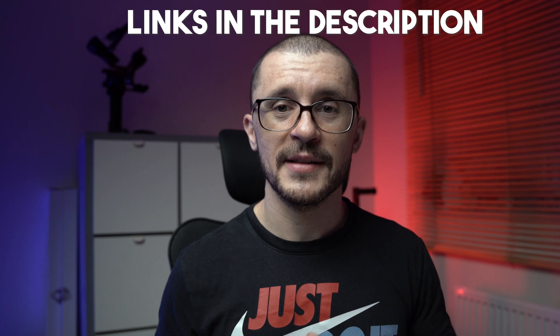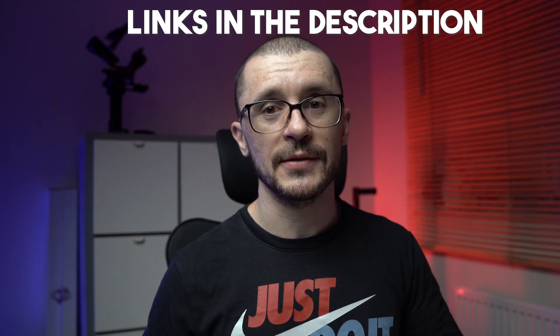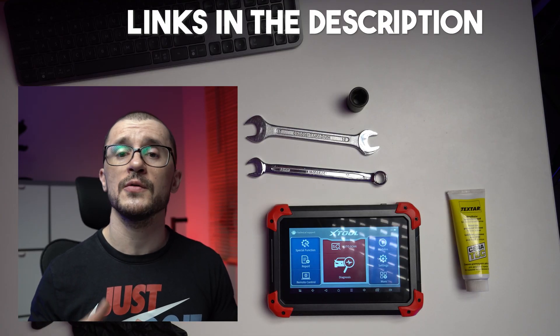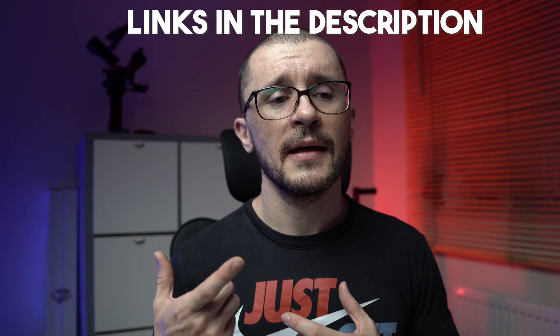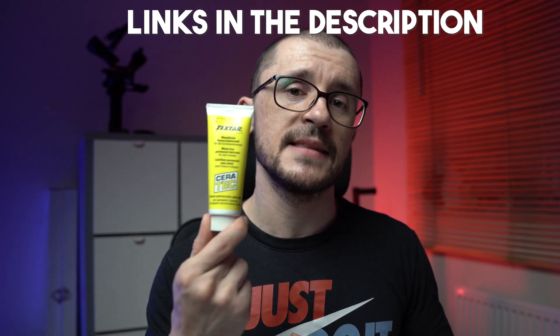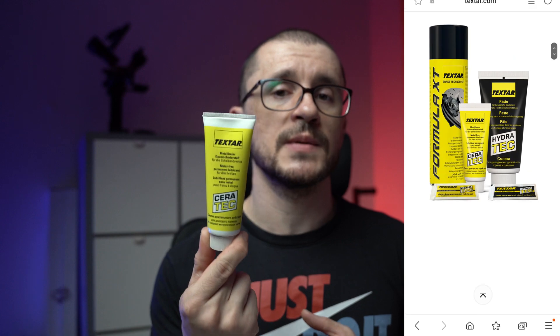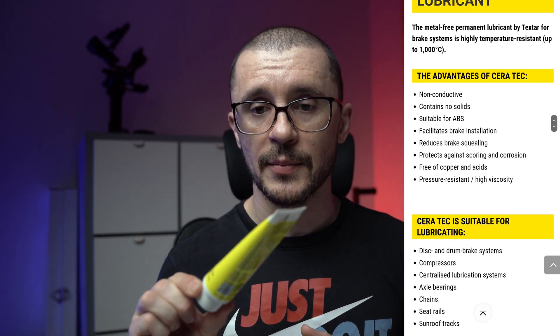To sort out this issue that will seriously affect the way your vehicle is performing, you will need the following main products and tools. The main thing is a diagnostic tool that will allow you to disengage your electronic parking brake. My tool of choice right now is the Xtool D7 — quite easy to use. I also have the original BMW Ista, but this is far easier to use. Another thing really worth its money is a dedicated brake pad lubricant designed to withstand up to 1000 degrees, ensuring your brake pads will be sliding correctly.